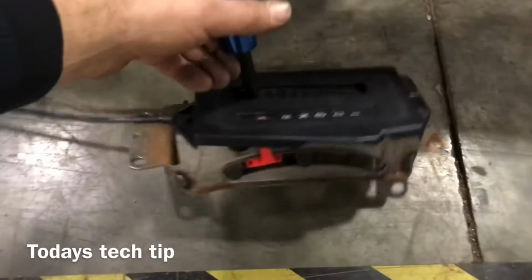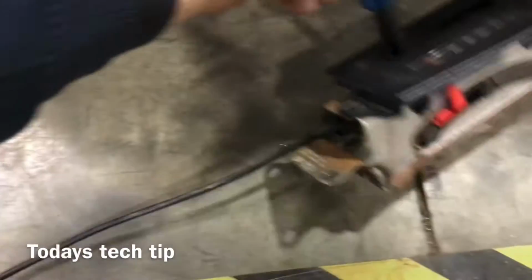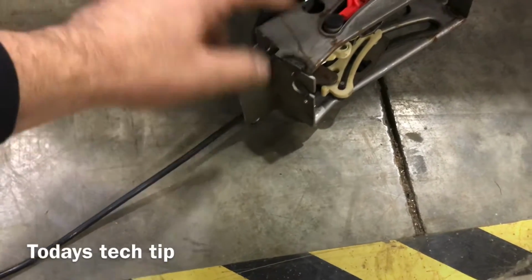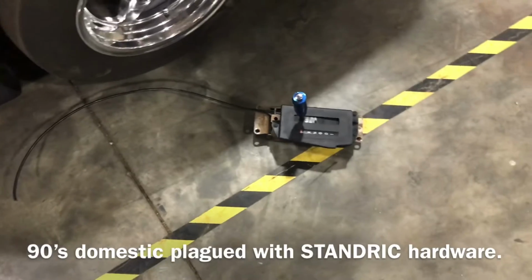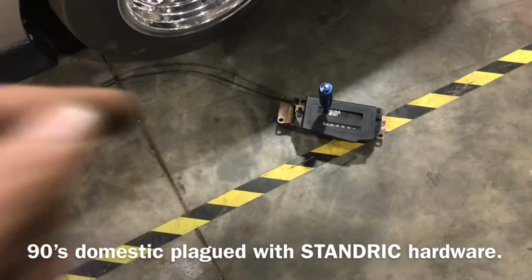FYI, if any of you ever go to take these out, 2 bolts in the back, 2 on the top, and then the cable actually exits under the vehicle. You have to disconnect those 2 bolts as well from underneath. So that'll leave you guessing. Don't rip on it. Pull out those 2 bolts. And of course the T-Bird is one of those vehicles that use the magical combination of standard and metric. I think the top bolts are all metric. Those bottom 2 for the cable are 3/8.